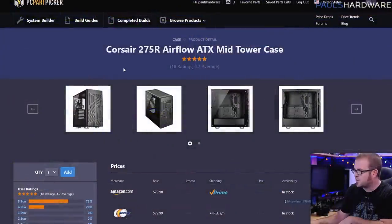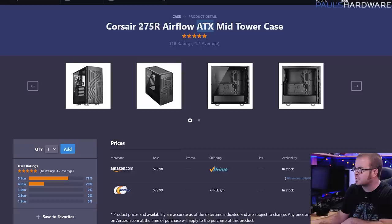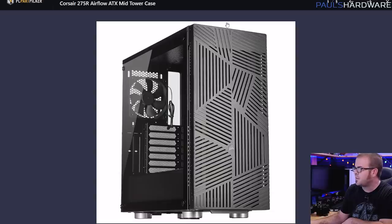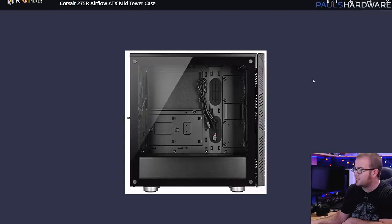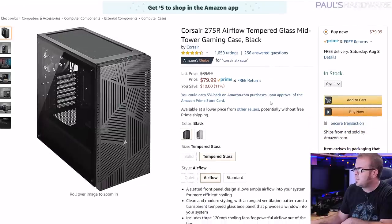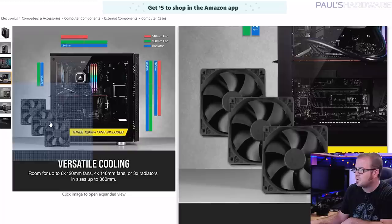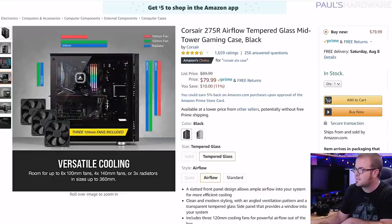Case is always one of those somewhat arbitrary choices. We want an ATX case to fit our motherboard. I'm going with the Corsair 275R Airflow version. It has a unique-looking front panel, and case decisions are often an aesthetic choice, but functionally this case has a nice open layout inside. It has a power supply basement at the bottom to hide your PSU cables, and a tempered glass side panel. It's $80 and available at Amazon, and it ships with three 120mm fans, so you won't need to add any more fans — that's adequate airflow even for a system with a discrete graphics card.